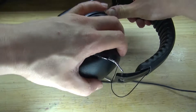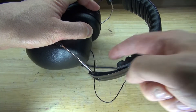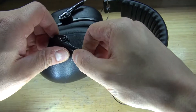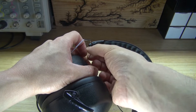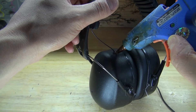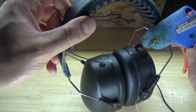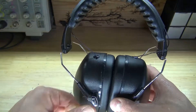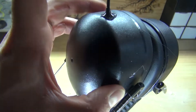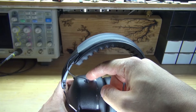Adjust everything to make sure the wires are not too tight or too loose. Here I realized I made a mistake — I should have put the wire through this little hole, just like on the opposite side. But that's okay, just a little adjustment and it'll look better. Take the wires and push them through the hole of the earmuffs — just a little bit. Now take some hot glue and seal the hole, doing this will seal the sound in better and keep the wire in place. Do the same thing on the opposite side. And there, the top part is now complete. Take some more hot glue and place it where the headphone jack is, pull the wire up straight, and let the hot glue solidify in position so the wire stays in place. The glue is now solidified.